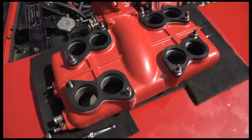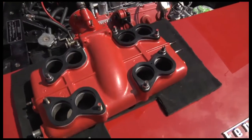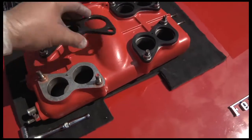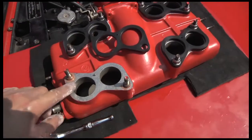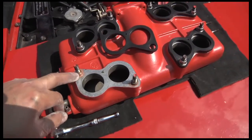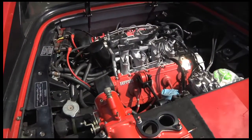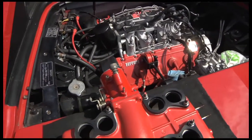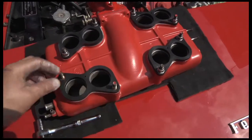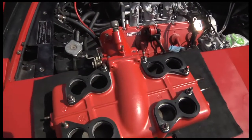I've been waiting for my powder coating stuff to come back. It's all done in the satin finish as you can see. I said I was going to silicone these on, so if I take the plenum chamber off again — hopefully not for a long time — the silicone obviously stops these rings falling down the holes on the engine, so the intake. I've put those on and then the rubbers, nice new rubbers just over the top. I clamped them down with washers overnight while they set, and then that was that.